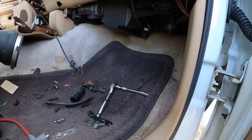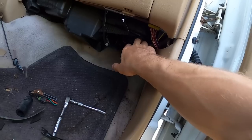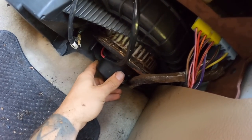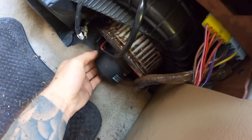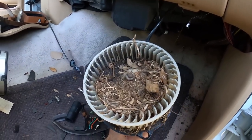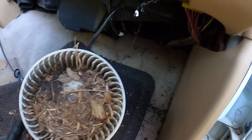Not really critical, but I was curious — the blower motor hasn't worked. This thing was full of rat's nest before. I'm going to take out three screws, pull this out, and see how ugly it is in there. Check this out — this thing is absolutely packed. There's a little hose on it and the whole housing is jammed full of debris.